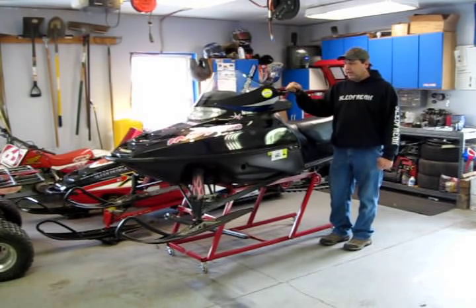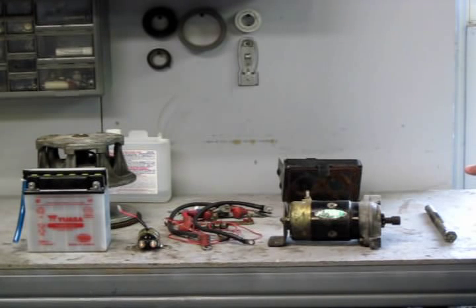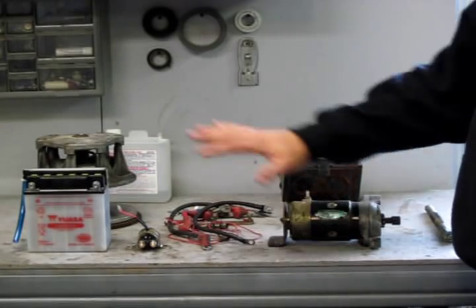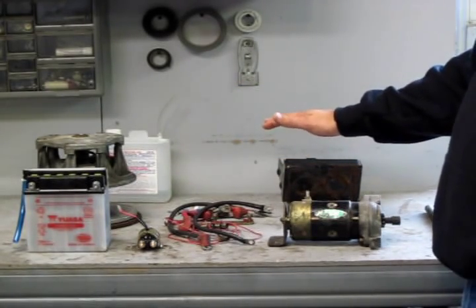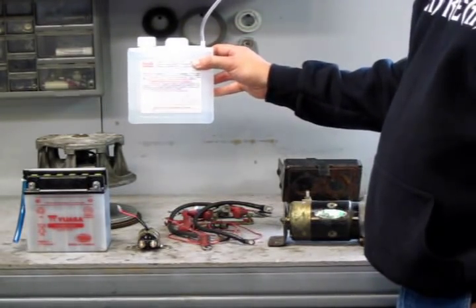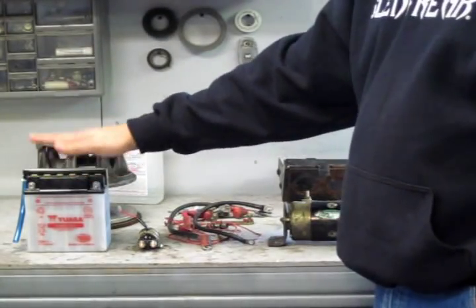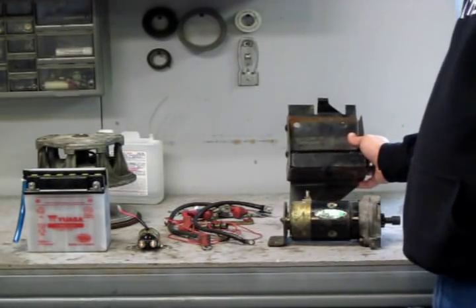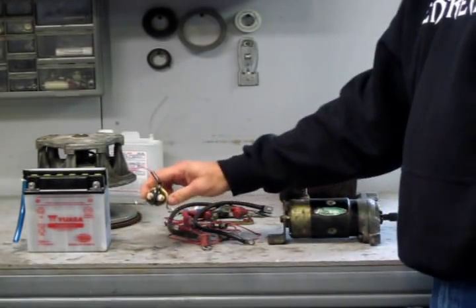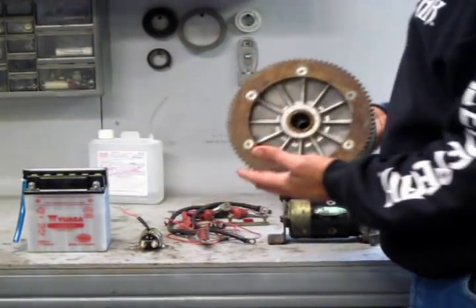Like I said, if you have a sled that's hard to start and you're thinking about putting an electric start in, you can watch us put it in — it's real simple, do it yourself. So come along and we'll show you how to do it. Okay, so this is everything you're going to need. Everything you see here came off of eBay, believe it or not. The battery, when it comes, if you're lucky, will have a box of acid in with it. If not, go over to your local automotive store and pick up a bottle of acid. Fill it up, charge it up. Battery box. Your starter, of course. Solenoid. Your wiring. Your hold down for your battery box. And your clutch with your ring gear on it.